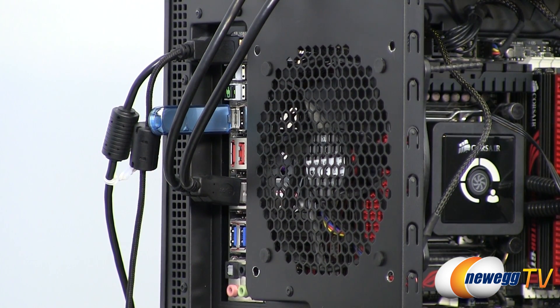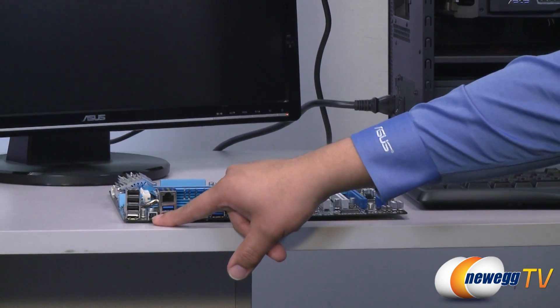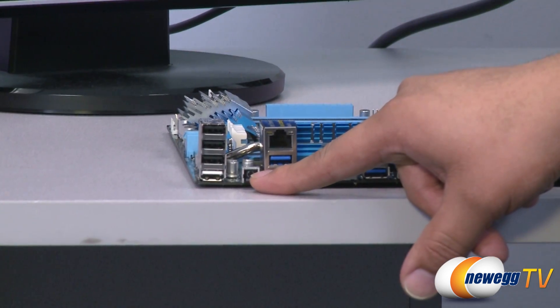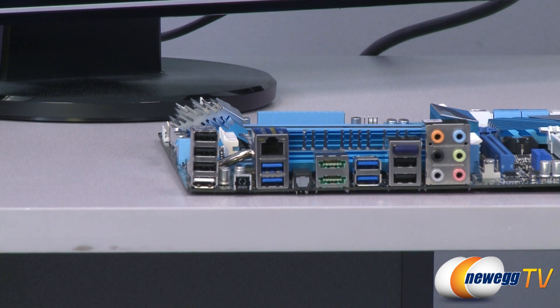If we could see the actual LED light here on the board, it is also blinking directly above the ROG label. For the channel boards they don't have a light on the actual BIOS chip, so this button itself actually has an LED built into it, and that will blink blue indicating the flash process.